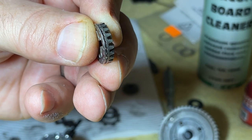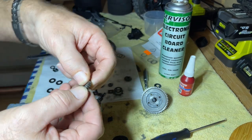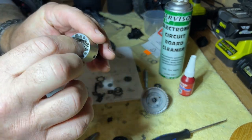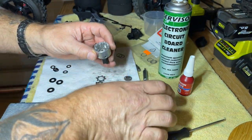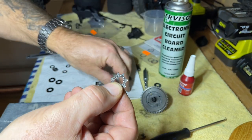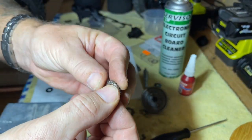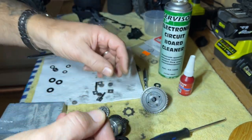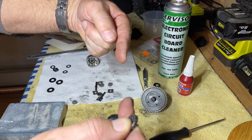You can see the shims in there and the roll plate is at the back, still engaging on the sun gear. What's happened is that sun gear has raised up 0.4 of a millimeter. I did exactly the same on the crown gear side — one of those shims, a locking plate, another locking plate, the other sun gear, another shim underneath the sun gear, then the locking plate on top. That puts 0.4 on the other side, pushing the sun gears into the planetary gears, because that is what you need for a tight mesh.